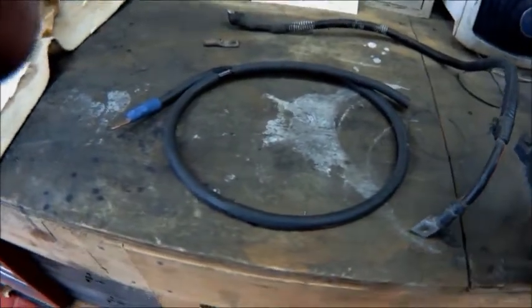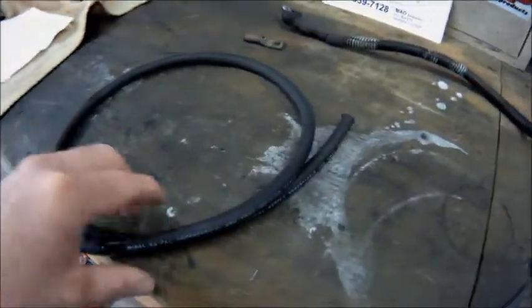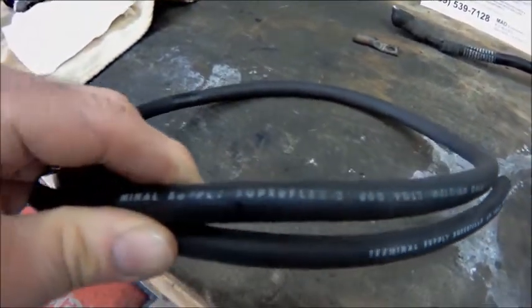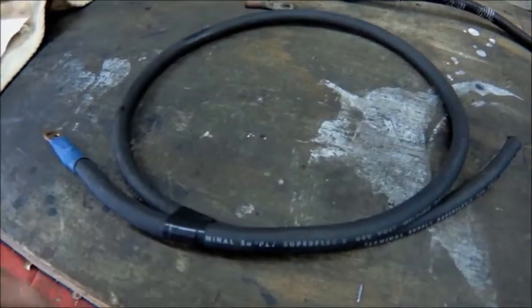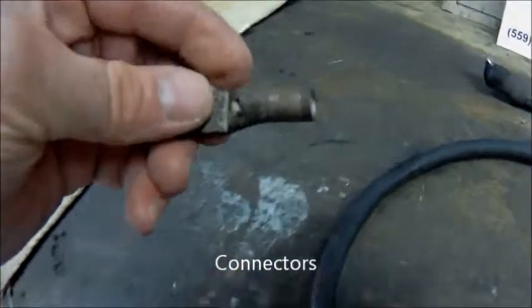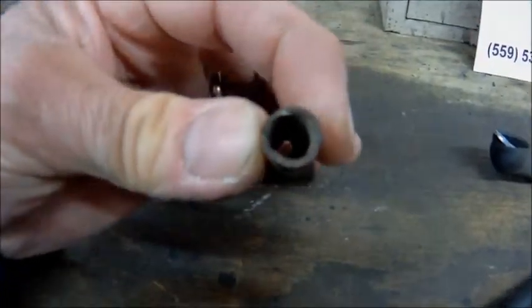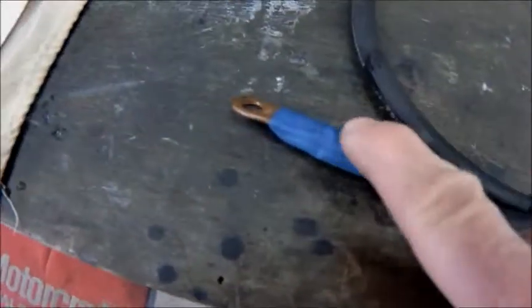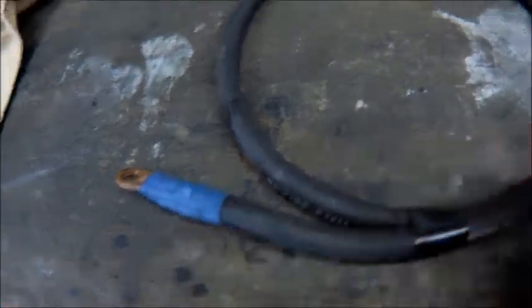One other thing I wanted to show you is what I use for my starter cable — it's 600 volt welding cable, is all that it is. This is what I run on my car back to front to the starter, and that works great. I also use these kind of fittings I got from the hardware store — from Lowe's. They're kind of an industrial thing but they work good for this application. They're a thick wall, so in order to make it easier to crimp, I cut this down the middle, then stick the cable in there and just take a hammer and chisel and crimp it down. Make sure you use shrink wrap on all your connections so they stay clean and dry.